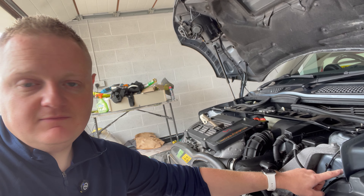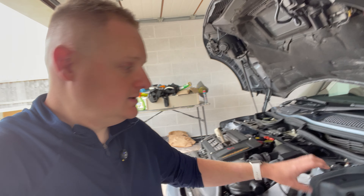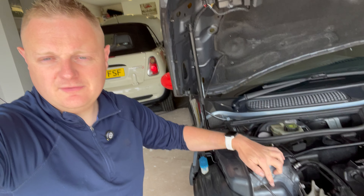It's one of the last cars produced in this generation. Because it's a facelift, you can see we've got these little rubber bungs, because the chassis was the same for all the R52s and R53s — they had those holes in the chassis ready to go. So we can move some bits out of the way in the engine bay and bolt these with eight bolts straight to the chassis. Now if you have a pre-facelift car — that's roughly 1999/2000 all the way up to mid-2004 — you'll notice the difference with the different headlights and interior details. If your clock is up by the mirror, yours is a pre-facelift. You won't have the drilled holes.